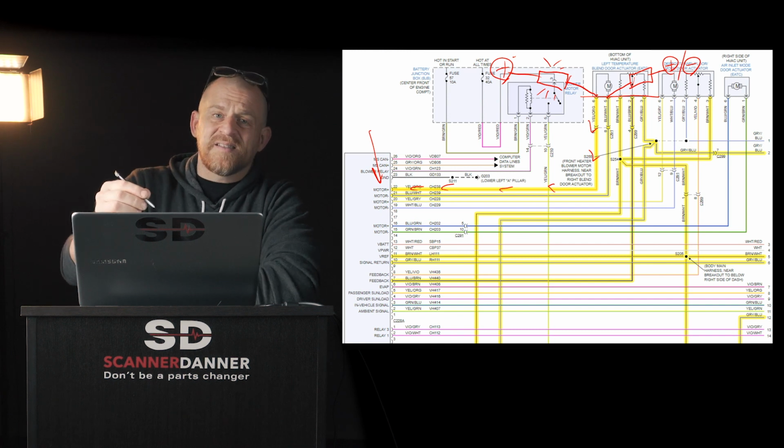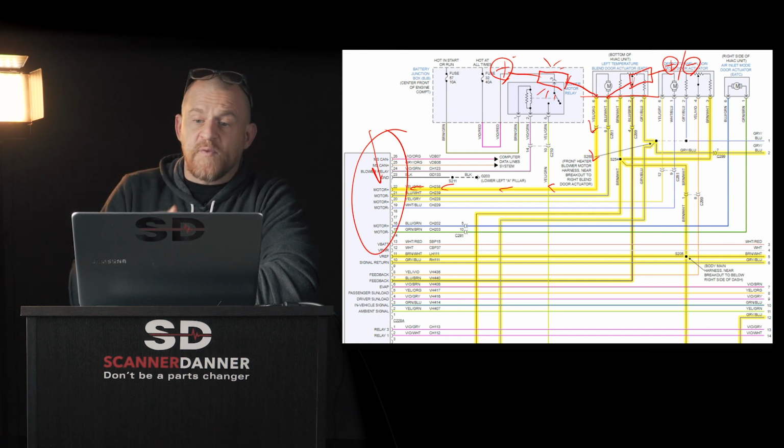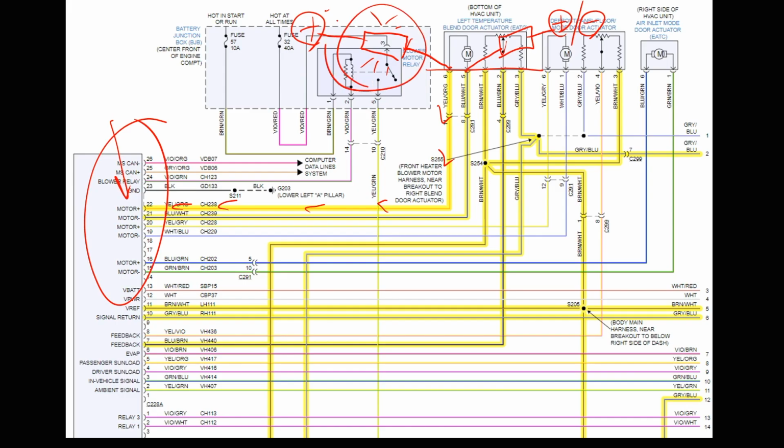And in that case, that would be testing the module motor circuit for control. If we have that and the motor's not moving, you're pretty much done. Would you agree? If I have a test light that flickers on positive and negative on both sides, and that's carrying a current flow too, the wiring and the computer are fine. If that motor's not turning, that motor's faulty, or you have a bound up door, okay? In which case you would have some pretty heavy amperage. So that'd be one way you could check the motor.